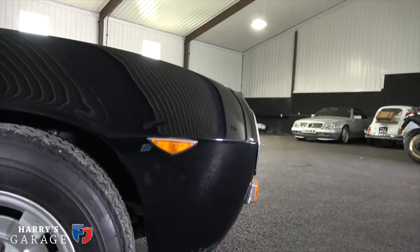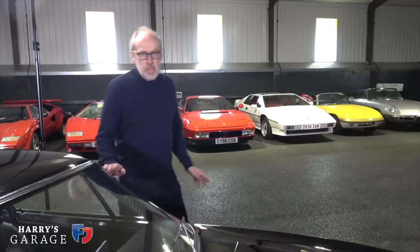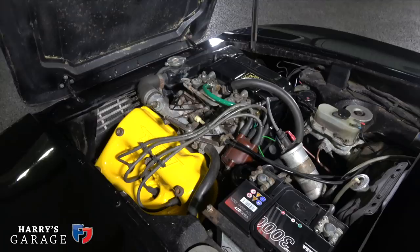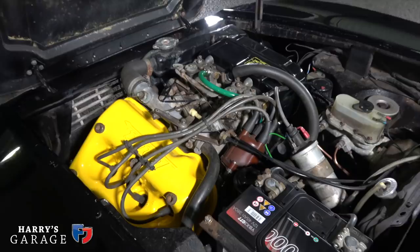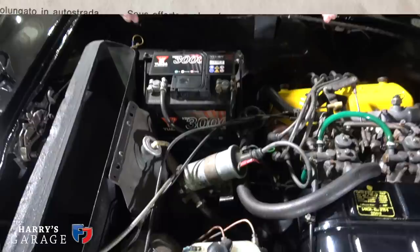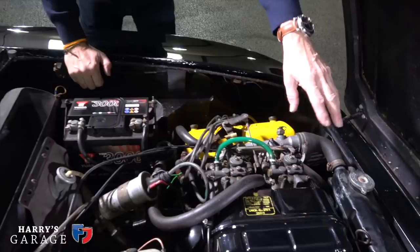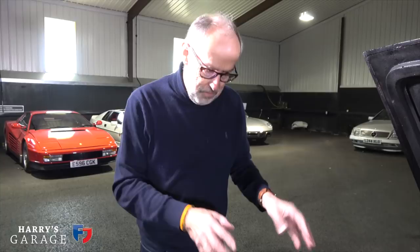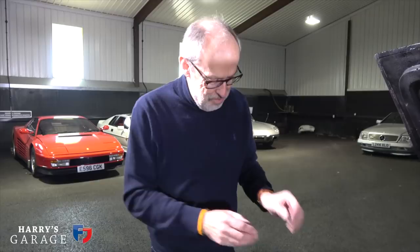What you've got to remember about these little Lancia Fulvias is they're front-wheel drive and they have a really unique engine — a V4, but a very narrow angle V4, which means it has a single cylinder head. It's peculiar because you see the four plug leads all coming in together. The engine is canted over at an angle and on this one you have twin Solex 40 carbs. The gearbox sits here as well and it all sits on a little subframe, right out at the front. At the time this was up against Alfa GTVs, which had a twin cam and rear drive — but this was front-wheel drive. It was a really trick, typical Lancia; they never did things normally. The early versions even had a side-hinged bonnet.